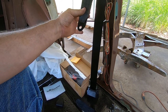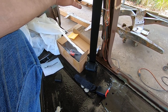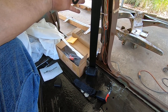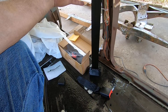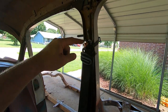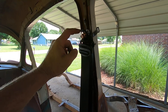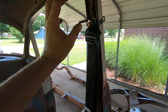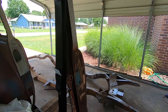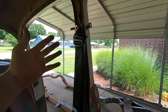It's going to take a little bit of fabrication to make these work, but at the end of the day I'll feel more comfortable that my wife's in here with a shoulder belt instead of just a lap belt. It does come with a bolt already, but it's metric so I'm going to change it out to a standard bolt. I have so many extra ARP bolts — some of those ARP bolts are stronger than a grade 8 — so that's what I'm going to use.